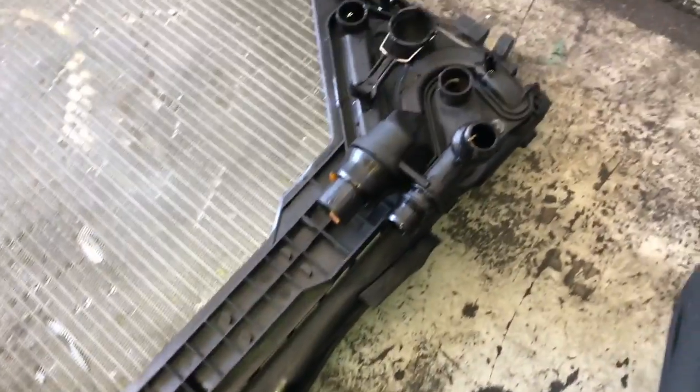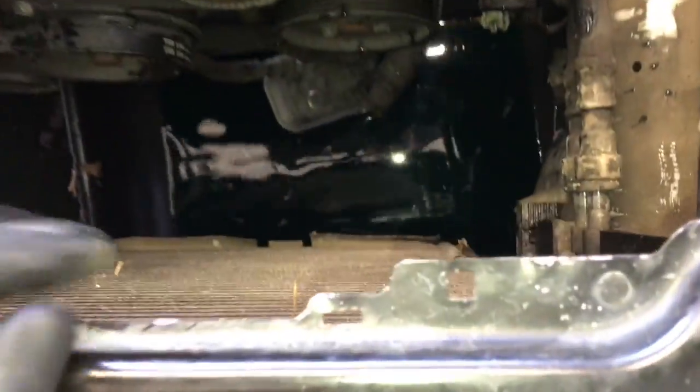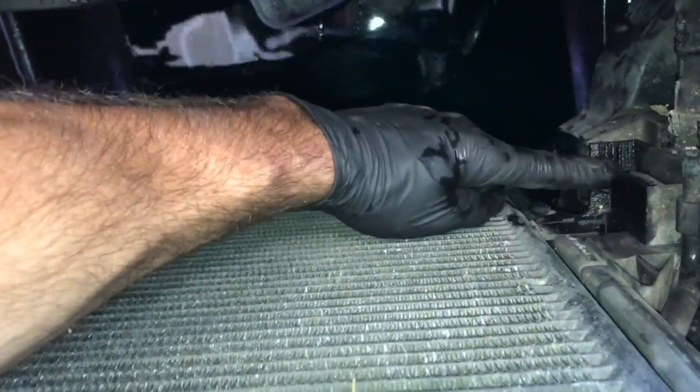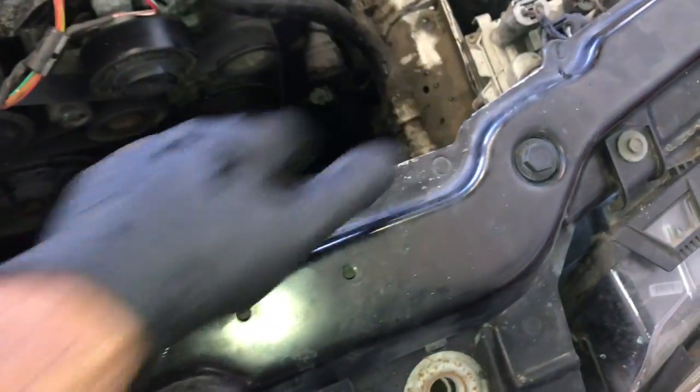This piece on the radiator is actually a brand new piece. When doing these jobs I recommend replacing the reservoir and this plastic plate that mounts onto the radiator — I'll link it all up in the description. The radiator mounts on a little perch — when you install it you push it downwards, then push it towards the condenser, and it mounts on the corners.